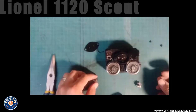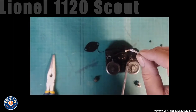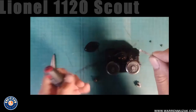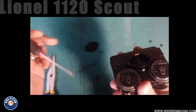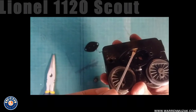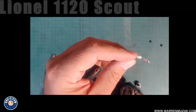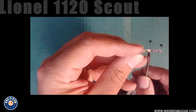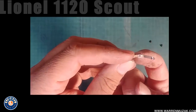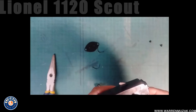I'm going to have a look at these contact springs. Each one has a hole in the center and there's a little protrusion or tab sticking off one side. Inside the housing itself there is a little tab on this brass piece — you want the hole to fit over top of that. You want this little brass tab sticking off the spring to face into the motor housing. So the hole slides over the tab in the housing and the protrusion sticks inwards towards the housing — that will be the proper position of the spring.